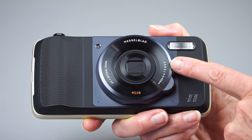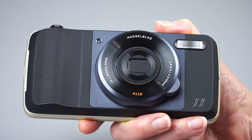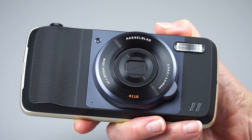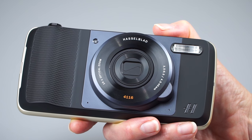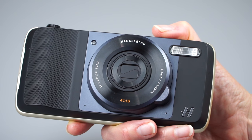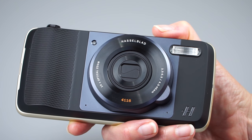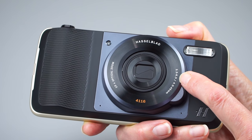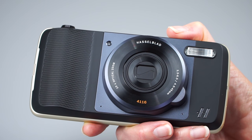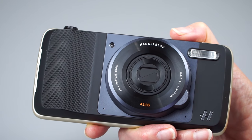The aperture on this — you can see right on the lens — is F3.5 to F6.5. That is pretty limited. The aperture refers to how wide open the lens gets relative to the sensor size. Nicer camera phones these days are F1.8, and smaller numbers are actually better. So you're looking at a lens that's fairly dark, particularly at the telephoto end. At the widest angle, that F3.5 is actually a lot darker than the Moto Z's native F1.8 lens. That's a little unfortunate and surprising for such a fancy piece of hardware.